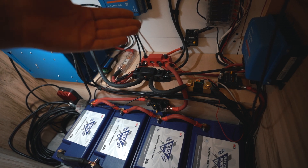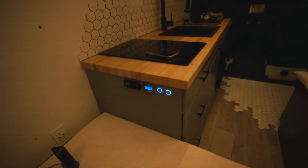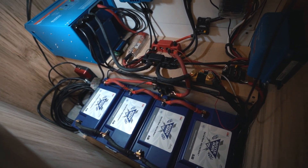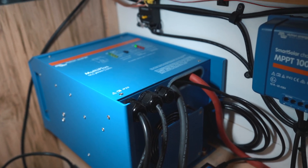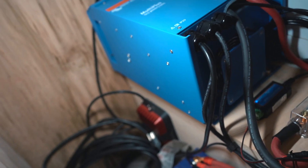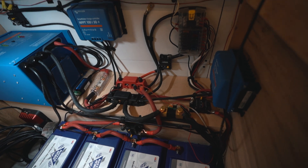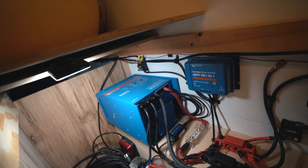This is my negative circuit. When energy comes in from these two systems, it goes to the positive, and if there's any extra, it goes to the battery. There are four 100 amp hour Battleborn lithium batteries in here — more than enough to charge the induction cooktop, the water heater, and everything else in the van. The MultiPlus inverter is really cool because it's not only an inverter but also a shore power hookup — this is connected to an electric extension cord so I can also charge the van at home, though usually when I'm on the road those are the two main inputs.